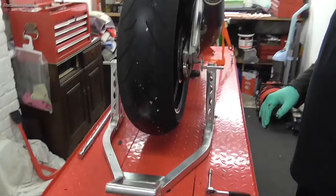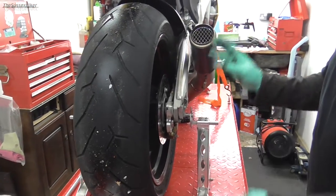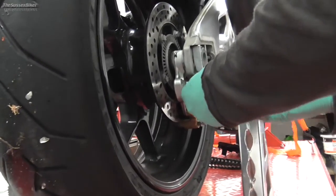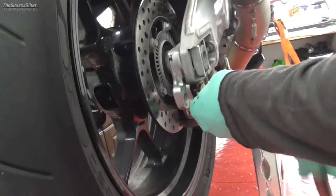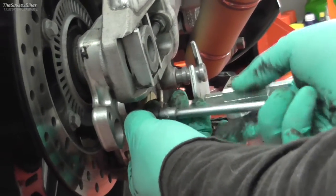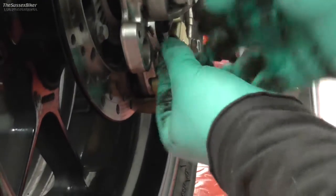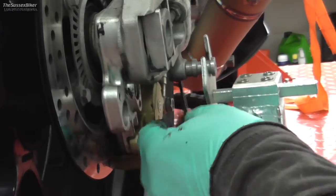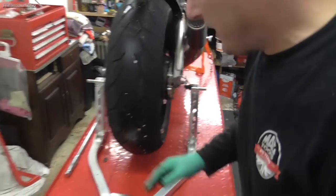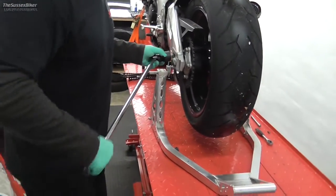What we've got here is the caliper carrier. I think it will stay where it is but just in case — because this part has ABS and the sensors are really expensive — it's only one 7mm bolt that holds it on, so I'm just going to as a precaution take this out and tuck it out of the way. So now we need to undo the back wheel — 32mm, should be fairly tight.